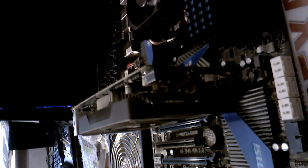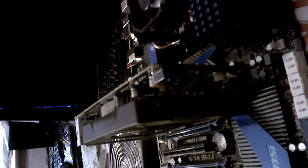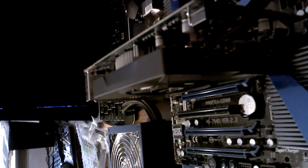So I'm going to go ahead and put the video card, bring this over the edge a little bit, making sure it's locked securely in place. Don't want to damage that. And as you can see, it has a spot for power supply. You need to give power to it because this particular one is a very powerful video card.